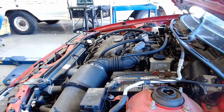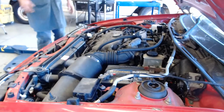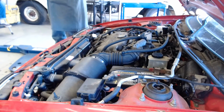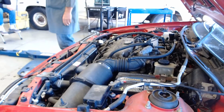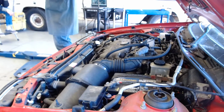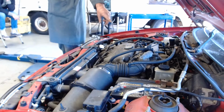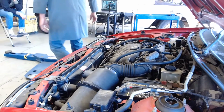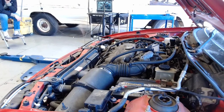Okay, let's pause for 1 second. What we have now is a car that cranks but doesn't start. We know the fuel pump's running. We heard it audibly, and we call that current ramping. We measured the current draw, and it was drawing current. So the pump's running. But how do we know if the injectors are flashing? We don't. So we're going to grab a tool called a noid light, and I put it out here.